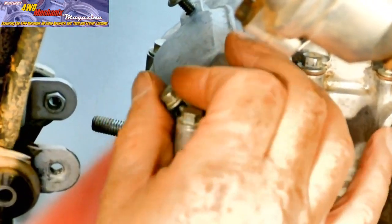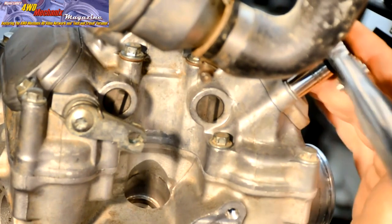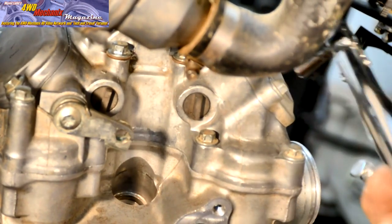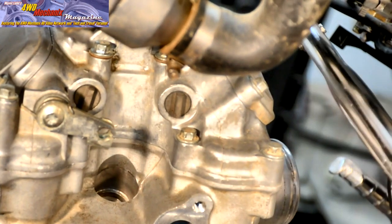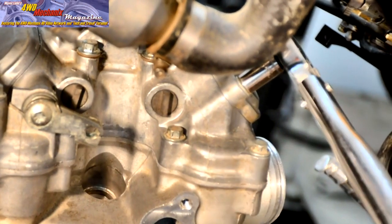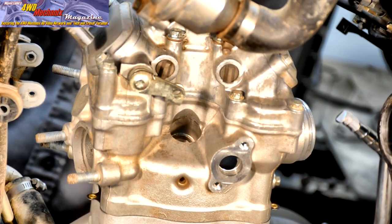This is all part of a periodic valve adjustment that is necessary to compensate for valve seat recession and wear of moving parts over time. Proper valve clearance adjustment assures accurate valve timing and also prevents the burning of valves that are set too tightly. When valve clearance is too loose, there's not enough valve lift and valve timing duration is also affected. For maximum performance and maximum longevity of the engine, it is essential that valves be adjusted periodically. The Honda service intervals are every 600 miles or 1,000 kilometers for inspecting the valve clearance. This may not require adjustment during each valve adjustment check.